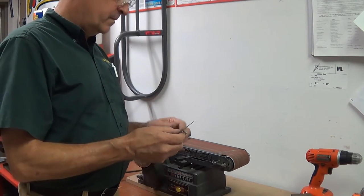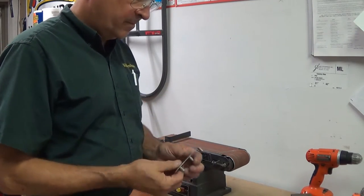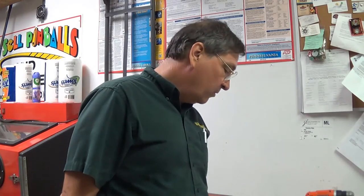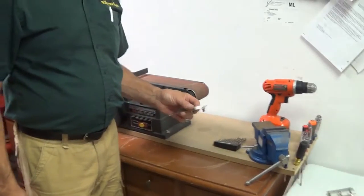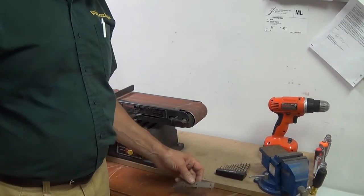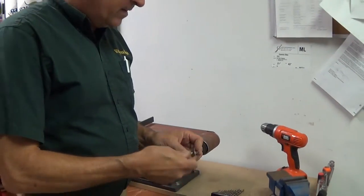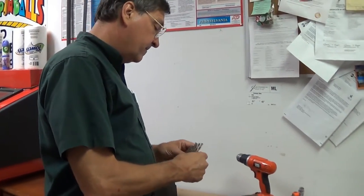Do you like it now? Yeah, it doesn't take much. If it does take much then you might want to try to find another one. I'm going to cool it off. So you take these off - you've never done this before? No, I'm not interested in doing this in the field. This is what you've got to do if you want ball hop to stop. Our tech tips is not for people running around in the field - this is for the homeowner, and this is even kind of an advanced thing. How would you get those out? You're going to take a drill that's the right size - quarter inch? Sure, be careful. This thing is dull.